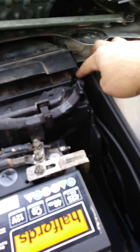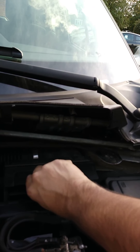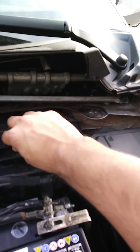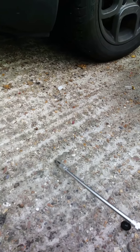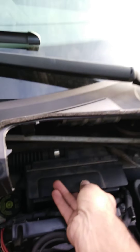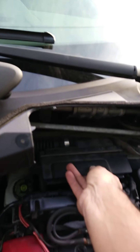The air filter is located in this box here. It has two screws, one here and one on this side. With a very small screwdriver you can unscrew those, or you can bend something and basically unscrew those screws because they're quite hard to access. Once done, it unclips like so and out pops the air filter.